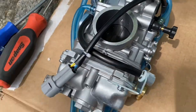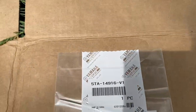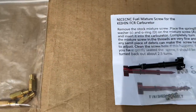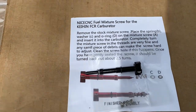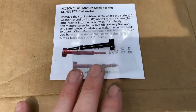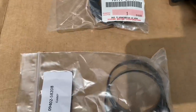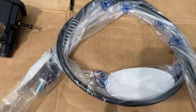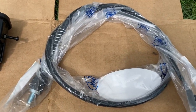This carburetor came with all the extra lines. It's got your pilot jet, it's got your main jets. Now I suggest when you guys do this to buy a new needle. And then this right here is your fuel mixture screw - this is an on-the-fly adjustment. You can use a small screwdriver but it's a pain in the neck. This is your DRZ coupler to the head to the carburetor. Got some new clamps. This is a Honda 400EX thumb throttle, and this is a Motion Pro Plus 2 throttle cable, also off of a YFZ 450.